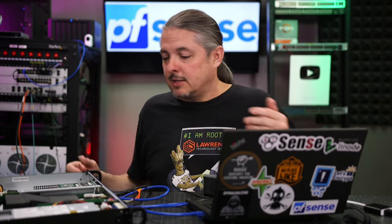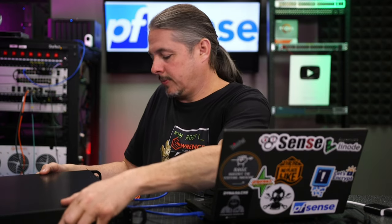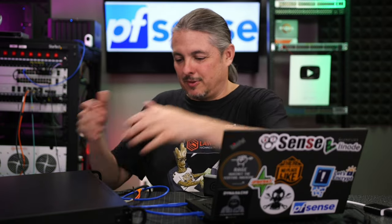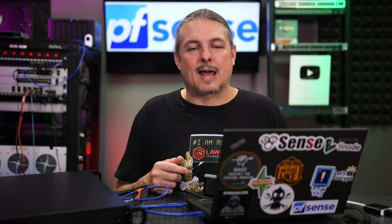Staying back on topic, it's a pretty nice device. Rack mount, standard Super Micro chassis - if you've seen this type of chassis before, it's a solid system. Even without the cover on, it's really quiet - the microphone's right here and it's not even picking up really any noise from it. The decibels are really low, so it's not obnoxious. We put the lid on and it gets that much quieter. Nice airflow from front to back. We've actually had this running for a couple of days on the test bench and I never even heard the fan ramp up, though it can ramp up a little louder if you find enough workload - like if you start running IDS and IPS systems with a 10-gig pipe coming in distributed to a lot of clients. The peak noise I got out of this was only about 70 decibels.